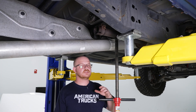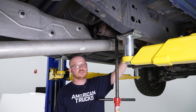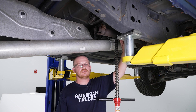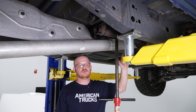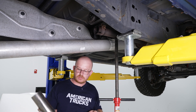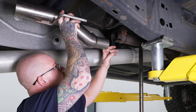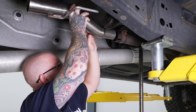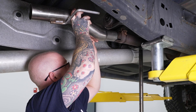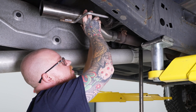Welcome back. For this exhaust system it's going to be reusing the factory resonator and flange mid pipe section. Once you have your exhaust off, you can go ahead and separate the resonator section and reinstall it as it was from factory using your 13 millimeter bolts. We'll begin with our first link pipe here that's going to go into our factory resonated section — this system only uses the second frame hanger isolator. We'll go ahead and get this lined up into our factory slip joint as well as our isolator.